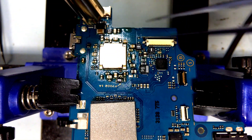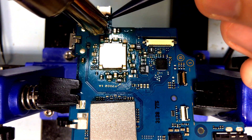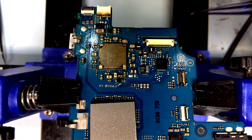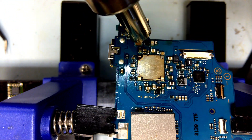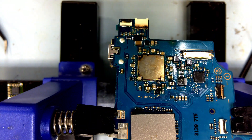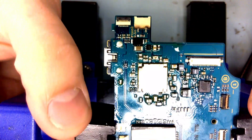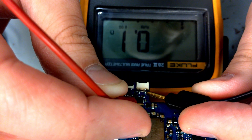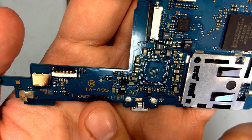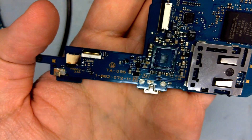And since we're here, why not replace the blown fuse? I don't have a good alternative to avoid toasting the charge port though. Checking continuity through the fuse looks good. To clarify, my donor parts come from a TA095 board that's in a PSP-3000 — it's the only one I know of that has its exact IC, and I can't find a supplier for the chip either. This board also conveniently has the same fuse.